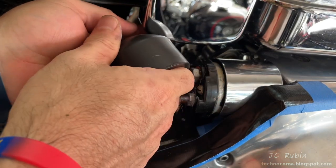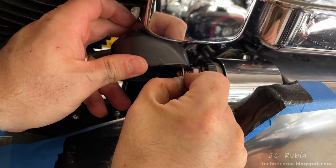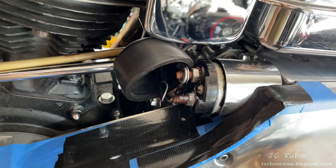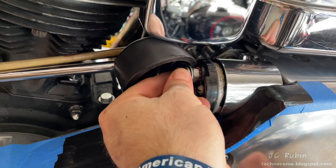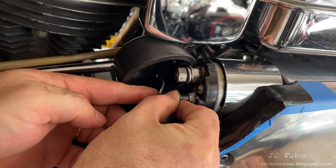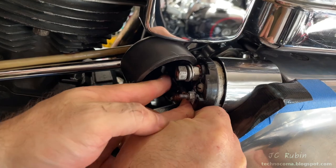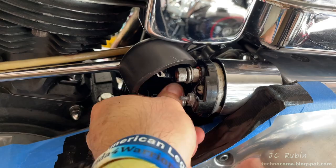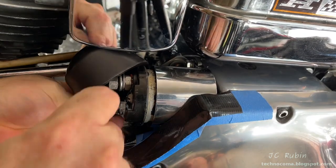As I put the old cover back in, it screws in with absolutely no binding — no problem whatsoever. Being sure to stagger the tightening of the bolts, it's pre-loaded because there's a spring in the middle. I put the three cables through the rubber boot, place the battery connection through the eyelet, put on that lock washer as well as the nut, and give it a couple of turns to secure it. Then I connect the other two cables — the small low current cable for the solenoid power as well as the switch power going to the starter.